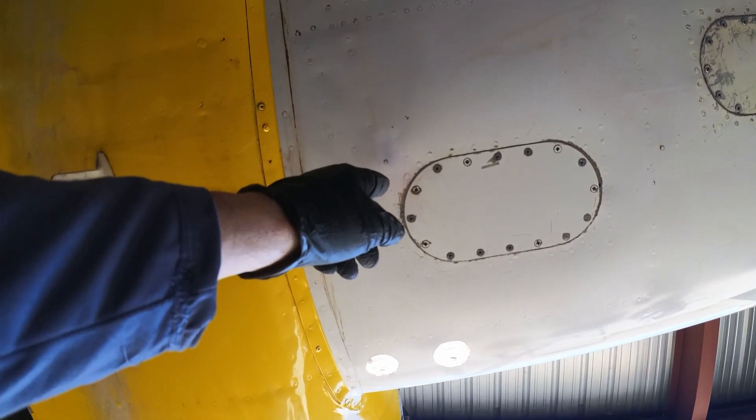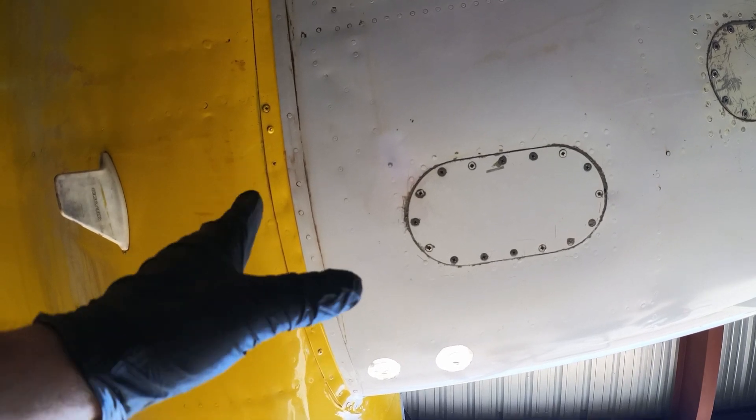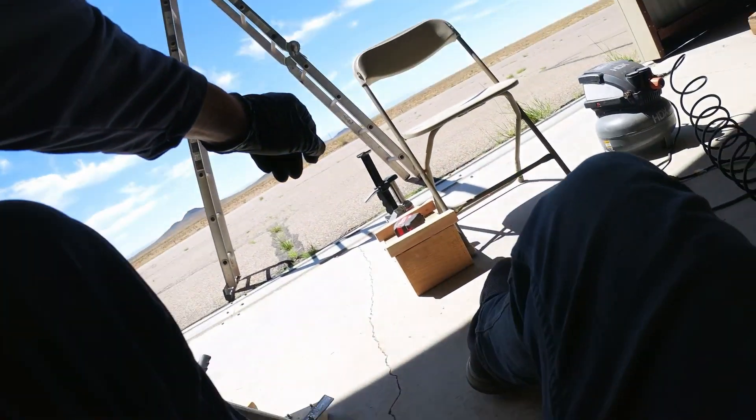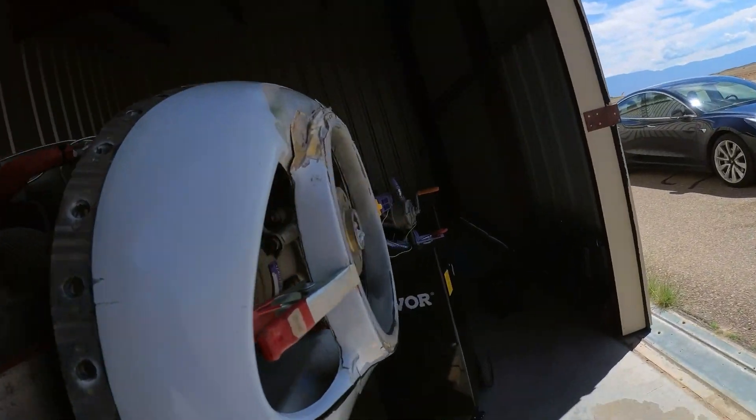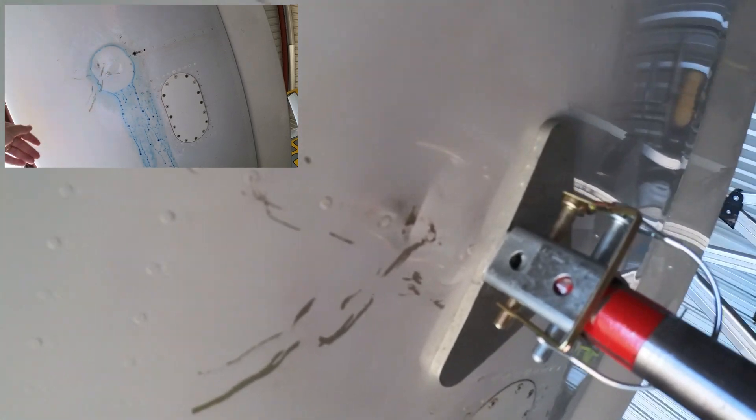There you go — I can't see any red but I'm hoping enough of it went inside whatever minuscule crack there is, and now it's going to set. I already did this to the other wing, which I'll show you now. That wing was weeping gas pretty bad — the wing is now full of gasoline, it's been full for a couple of hours. You can maybe detect there's a little bit of red sealant. I might have to do it one more time just to be sure, but basically there's no leaking. I was able to push the red sealant through whatever cracks the gasoline was coming out of around the rivets — so far so good.